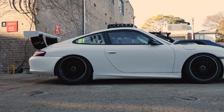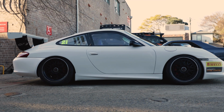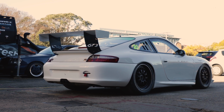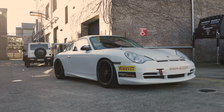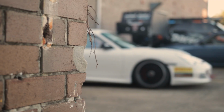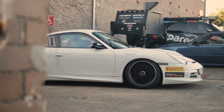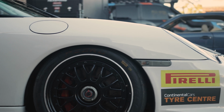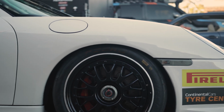But what makes it fast are the things that Porsche has spared no compromise on in turning into a race car. It's things like the Sachs remote reservoir coilover shocks, adjustable for dampening and rebound. That makes it fast. Massive slick tires, fully adjustable camber, caster, all of the angles, suspension. It's got a low ride height. It's got the roll cage for a stiff body. It's got the air jacks when you come into the pit. It's got the massive Brembo brakes that slow you down from monster speed, and huge air ducts that keep the brakes cold over and over again.